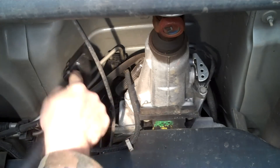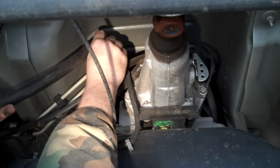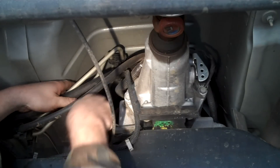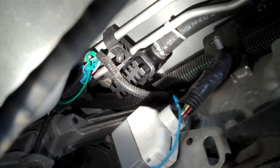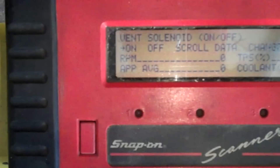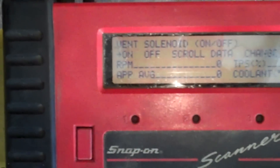Clamp the hose onto the filter and set it up above the transmission, then zip tie everything in place. Here's the new location for the vent solenoid inlet filter. With the new part installed, you can now hear it click when you turn it on and off. Now use the scan tool to clear the codes, then check the readiness monitors — it needs to be driven until the EVAP system monitor is complete.